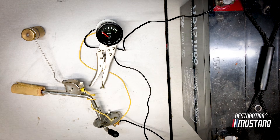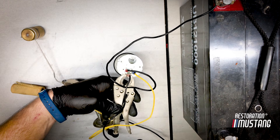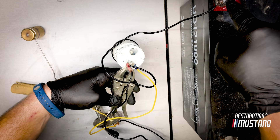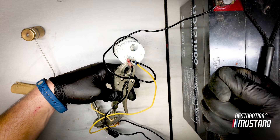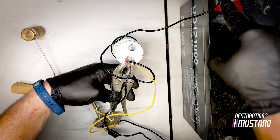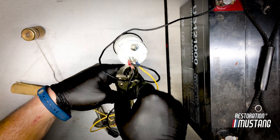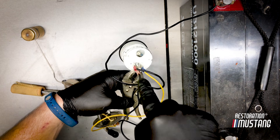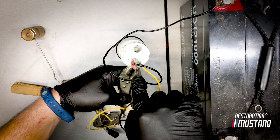This is going to be a simple test. Let me show you the way I have the connection made here. On the back of the gauge, you'll see I have a positive — this is going to the positive side of the battery. This would be your switched 12-volt source, so when you flip your key on, it gets power. That's positive. Negative is this wire here, simply going to a ground. This could go to a chassis ground or a ground inside your dash on your classic car. Just make sure it's a good quality ground.